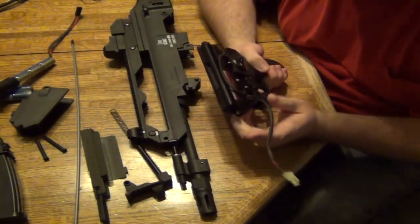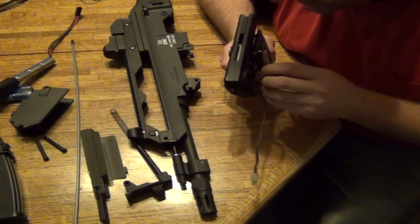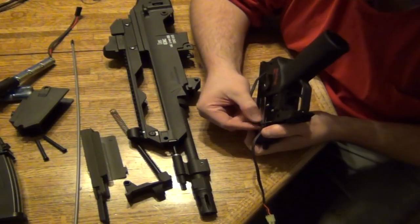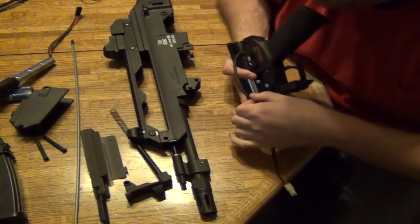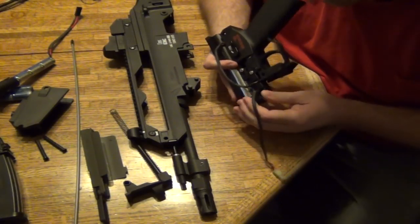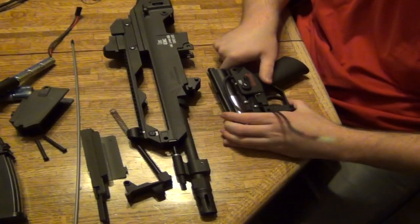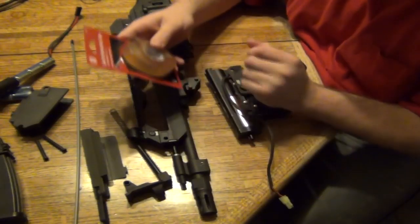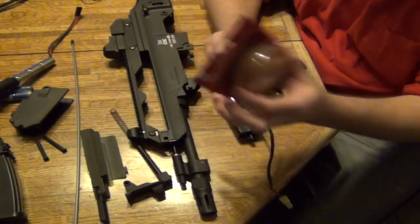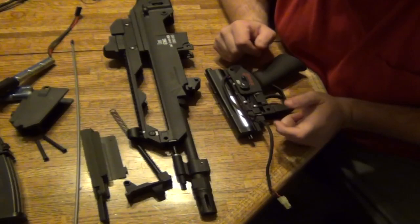There's the body and now we've got the gearbox. Check the gearbox wires. If you remember my last video about wires — here you can see it's actually starting to eat away at the heat shrink right here, getting pretty torn up. However, it's not down into the wires yet, so I don't have a short problem. You can replace that with this clear electrical vinyl tape. The reason I suggest clear instead of black is you can see where your cuts are and remember them.